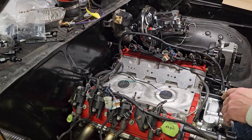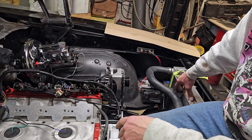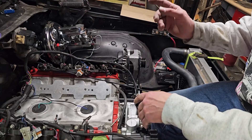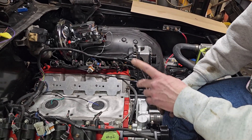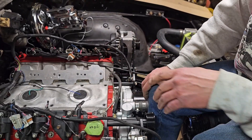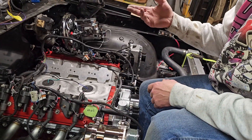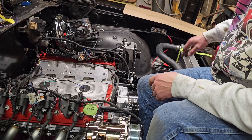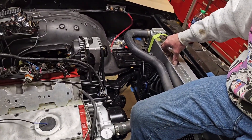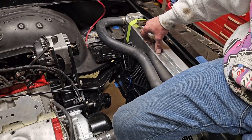There are two wires I just noticed — I'd like to mount our fan relays underneath the hood, but the fan relay wires must be inside the car right now. We're probably going to move those out here and put a relay out here, though it doesn't necessarily need to be that way — you can run your relays underneath the dash if you want. It will trigger fan one and fan two, and this is all controlled through your computer programming.